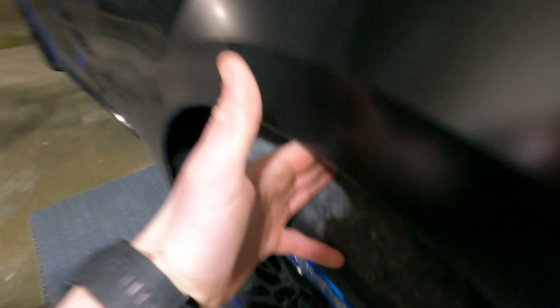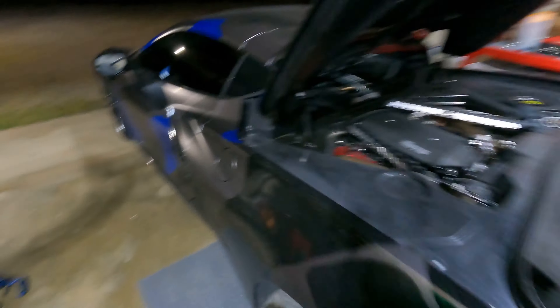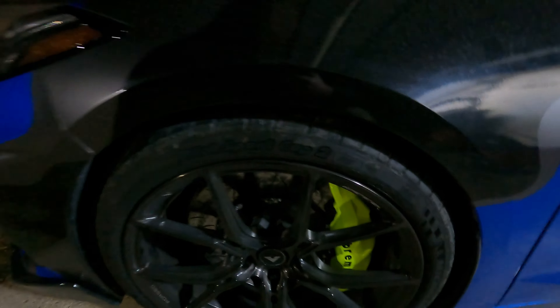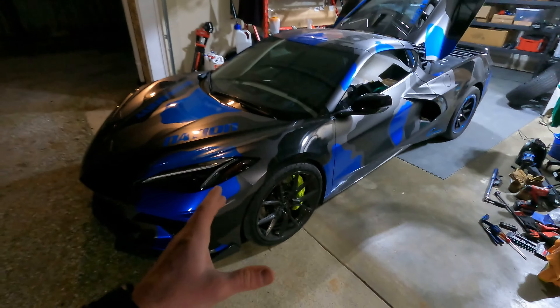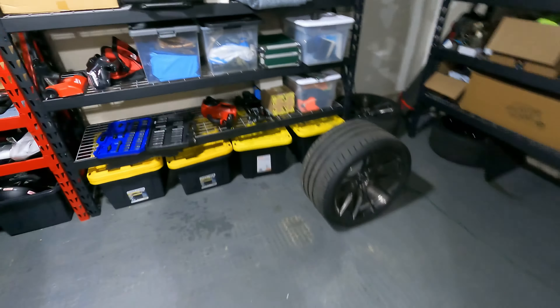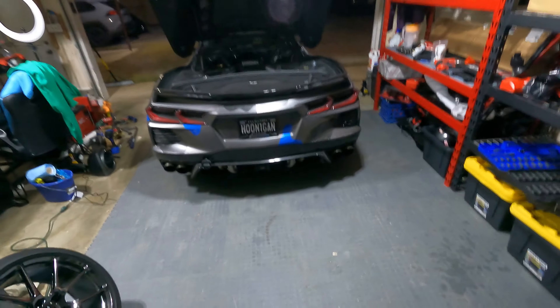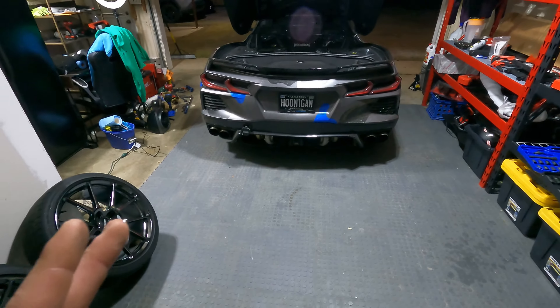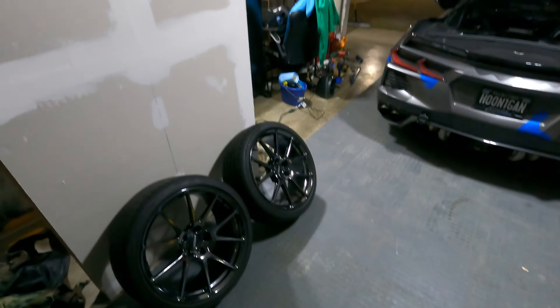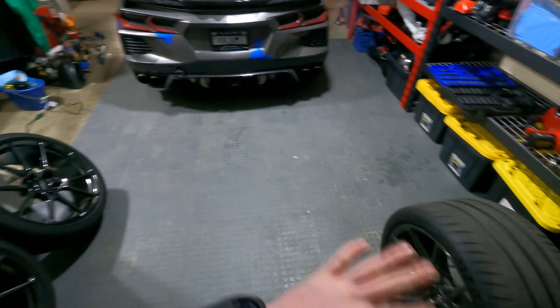I've got about a three-finger wheel gap right now, which is pretty sizable. I had about a two-finger gap before I lowered the car, but now it's about one finger because I did the Paragon Performance lowering. I bought their spanner wrenches which allowed me to lower the car on the Z51 suspension. I know these videos are a little ranty, but it's just because of the experience I've put myself through, both on purpose and by accident. You can run all-season tires on pretty much any of these setups.